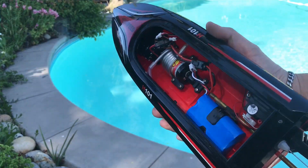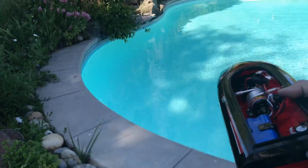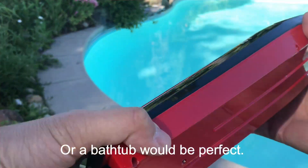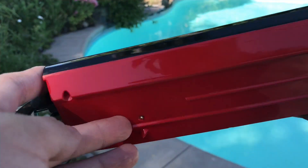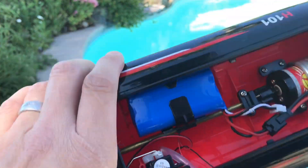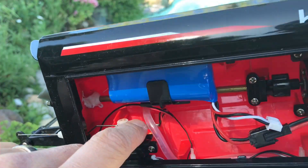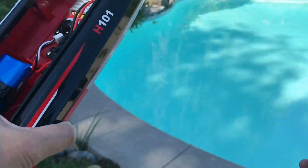We're going to do this by the pool so it's not lost in a lake. If you don't have a pool, use a pan or a kitchen sink — a large kitchen or garage sink works. You just want to make sure the sensor gets wet, because if it's not wet the boat won't turn on. That's the safety mechanism so the propeller isn't spinning and hurting you out of water. We've taken off the servo arm and we're going to reset it so it's centered — put the whole boat in the water, grab the transmitter, and put both sticks to the right.